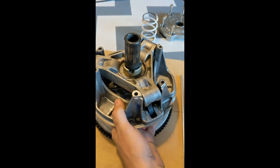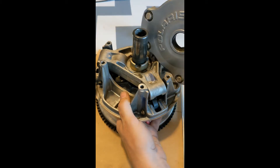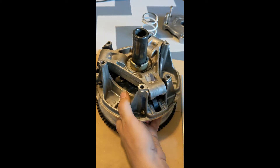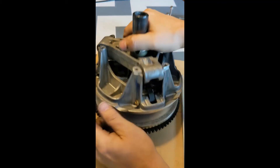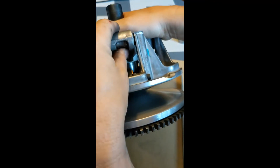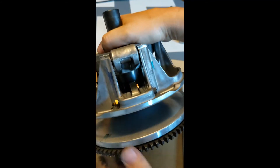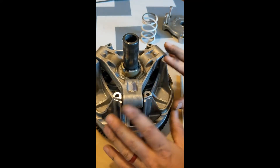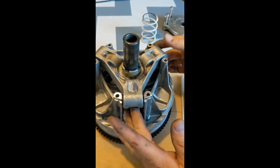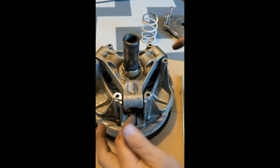Most everybody uses a Polaris primary — it says Polaris on the cover itself — so if you go to any Polaris dealer and take them your primary, they'll usually be happy to help with a rebuild. The rebuild is typically taking the spider and all components apart, replacing the buttons, and also replacing the rollers underneath the spider. There's a roller that rides on a little nylon fiber bushing, and those can wear out. If your roller is not rolling, that's a problem. While I have it apart I will spray some Teflon to soak down those bushings and keep everything lubricated and smooth.